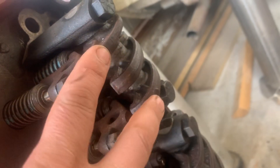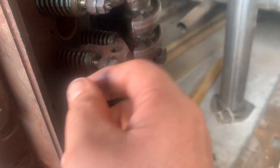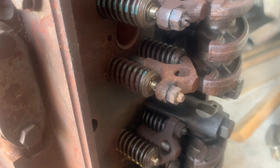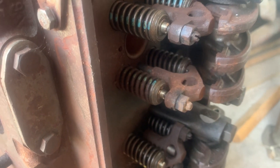The rockers are: two exhaust valves and one fuel injector - this is what squirts the fuel. It's kind of like a Windex bottle - it's pressurized fuel in the line at about 70-75 psi, and every time it gets pushed down it sprays out atomized fuel like a spray bottle. The amount of fuel is controlled by the rack - there's a lever in there selecting on the fuel injector how much fuel to spray. All four valves are exhaust valves, hopefully that makes more sense now.